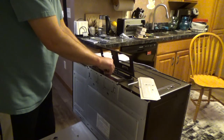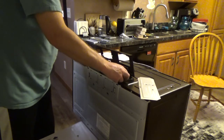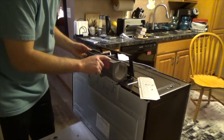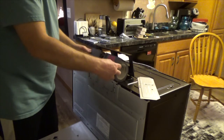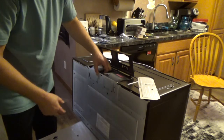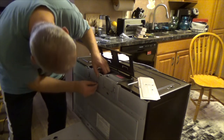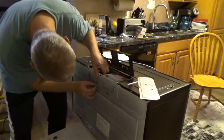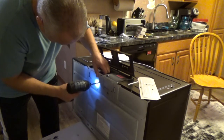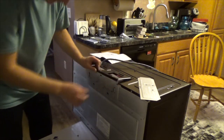Now I have to remove the blower. Gently move it out and turn it 90 degrees so the fans are blowing upward. I have to turn it 90 degrees and put it back in. Then I install one of the screws to secure the fan so it won't be wobbly, and put the cover back on.